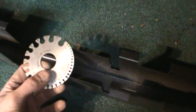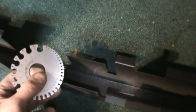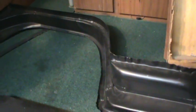Yeah, that's what we got for the thickness on this one. Probably 18. It's 18 with paint, because the 17 drops on it loose, so that's gonna be 18 gauge. And these feel and look lighter. Yeah, they're 20 gauge, so that's really thin. I believe it's 18 from the factory. Again, it's an aftermarket piece. Well, that's kind of what we're starting with.